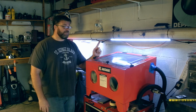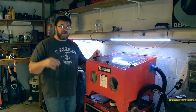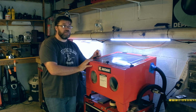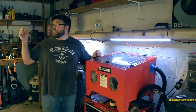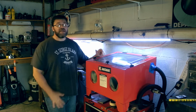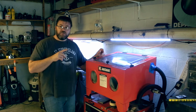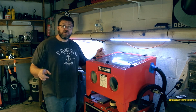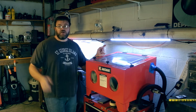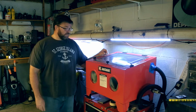The funny thing is, I found out that this garage, the way it's wired, does not like to run my compressor and the shop vac with the lighting when I'm doing this. I popped the fuses yesterday about 6 times. So I moved the shop vac to a different connection run to a different circuit breaker, and I didn't have any more problems. I love this little thing. The grate in it is kind of flimsy. I used it to clean the 88 rear knuckles for the Fiero, and they dented the mesh. It's not the strongest, but those are probably 15 plus pounds apiece. Other than that, it's a good little machine. Again, not sponsored.